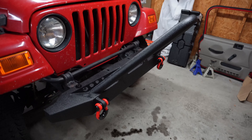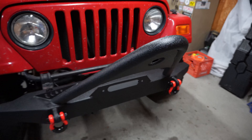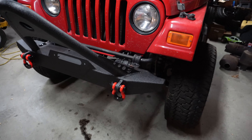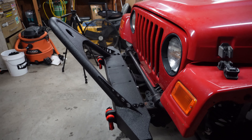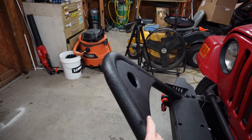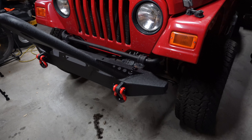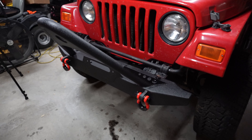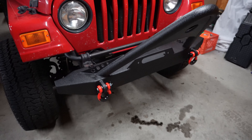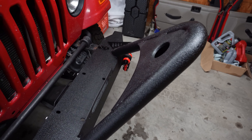I did the final torque on all six bolts with a ratchet instead of using the impact. Looks pretty good — I think I'm happy with it. I'm not exactly sure what I'm going to do for a rear bumper. I think I'm just going to powder coat the rear factory one with this same finish. This Jeep has a proper class three tow hitch, and I'd hate to get rid of that for the kind of cheap bumpers you can buy that you can't really tow with — you can use them for a spare tire or luggage, but not for towing.